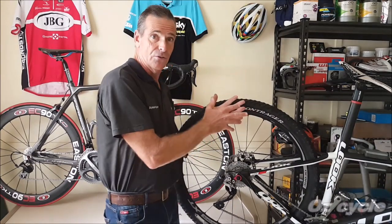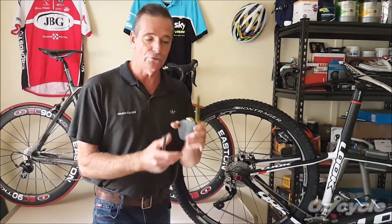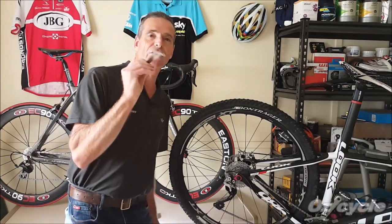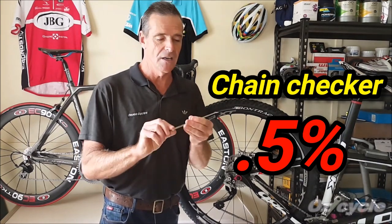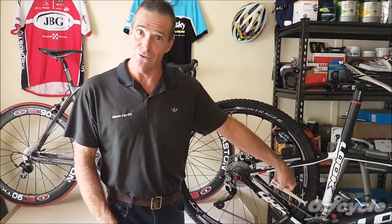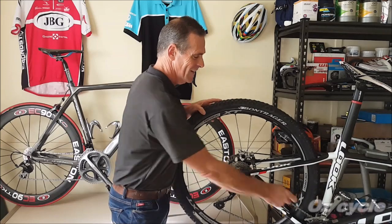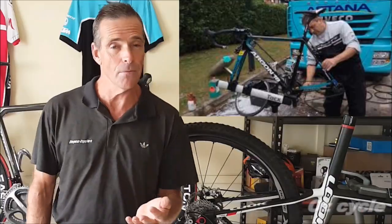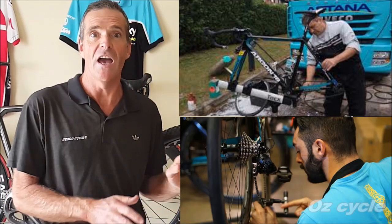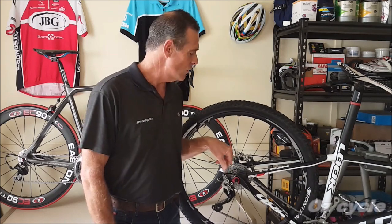When you go and clean your bike — every couple of rides or whatever — measure your chain stretch. Don't use a tape measure; they're inaccurate. Get a dedicated tool with a 0.5% wear mark on it. The Park tool is very simple to use and good value for money. If the tool doesn't go in, it's still okay to use. If it does go in the chain, replace your chain as soon as possible so it doesn't wear your cogs and chain rings. In the pro peloton, teams replace their chain every thousand kilometres and get three years of pro racing usage out of their rear cogs and front chain rings just by doing that. Worth doing.